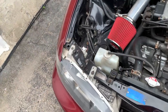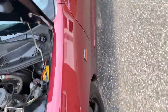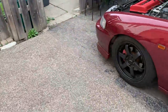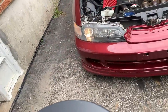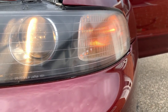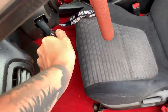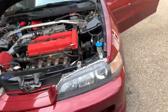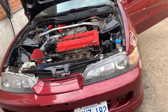After I shaved those ears down on the turn signal bulbs, they fit right in. I'll show you what that looks like right now. We've got the headlights on, and the turn signals are dual filament so they'll always be on as well — or you can bring it down so headlights are off and it's just your turn signals staying on, which is also pretty cool.